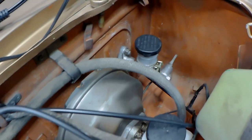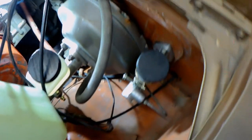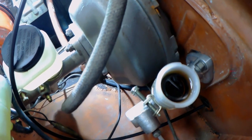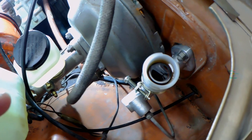along with the clutch master here. That clutch master was last replaced in about '94, I think it was. Let me walk over to it and grab a light to help see. The thing with clutches and hydraulics is, take the lid off here, you can see that the fluid's kind of dark. It's after only a year. I did clean it out some, drained out all the old fluid a year and a half ago when I got this car back on the road.